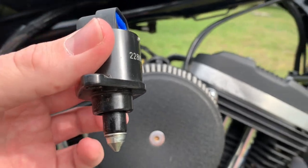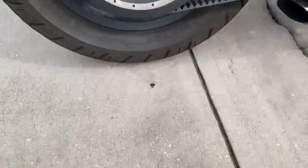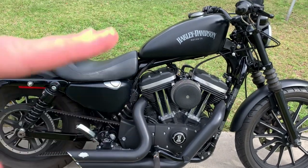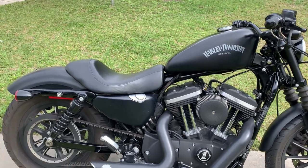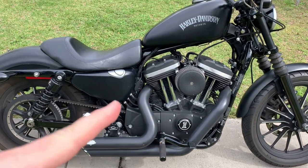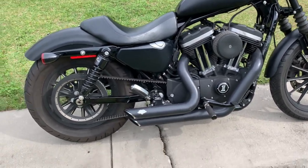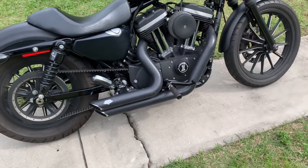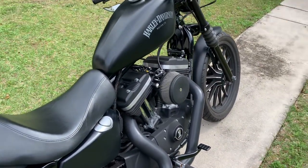I think it's called cold idle delay or something like that. Even after riding around, if we parked for 30 minutes and I started the bike back up, the idle would be right back up at 1600 RPM and it might take four minutes to drop down — just a slow gradual drop. With this manual valve I can start the bike up, run it at 1500 RPM for like 20 seconds, then give it one or two clicks and the idle will drop.